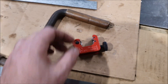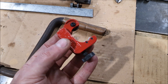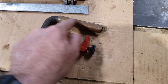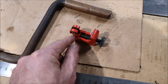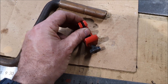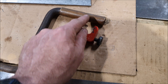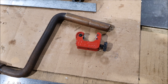I found my old tube cutter that completely doesn't work, which I think I can modify to make a little tool to do the crimp on the brass sleeve that goes on the starting handle. All I need to do is replace the cutter with a little washer, and hopefully if I anneal the brass to make it nice and soft that should be good enough to put that little crimp in there — and that's what holds the brass on the handle.